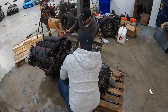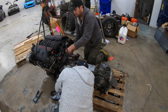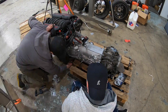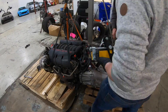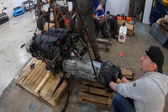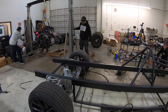And then we slapped that baby onto the trans, and lo and behold, it actually bolted up. So that's a 4L65E transmission — a four-speed transmission built by RPM Transmission, so it can hold some extra power, attached to a Corvette automatic rear differential. You can't run these in a manual configuration because the shifter linkage would need to run right through the middle of your engine, so you have to run these in automatic if you want to do this budget transaxle type of setup.